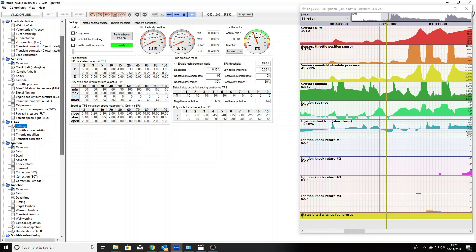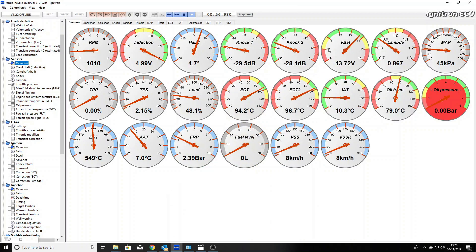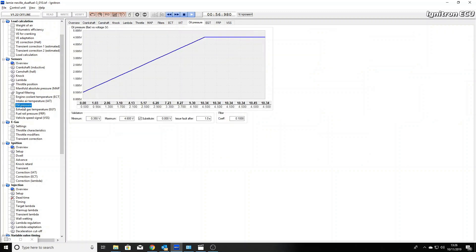In addition to that, you have sensors overview, which is a whole bunch of gauges. You can have extra sensors on there. We will typically add fuel rail pressure and oil pressure. Oil temp, depending on your car, will already be picked up from your dashboard — early cars that won't work if they're not CAN bus — but you can add external sensors to it. This is all visible data logging, and it's configurable: if you have a sensor and you know the scaling, you can create a scale for it. We use the same sensors for both fuel and oil, but you can just add these in.